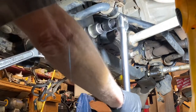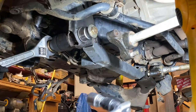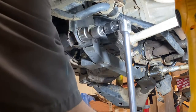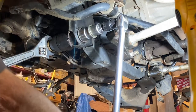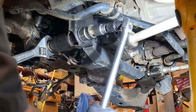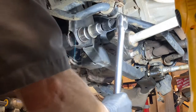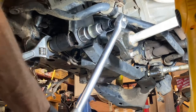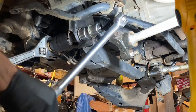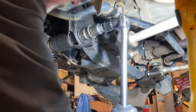Something definitely popped there. Let's keep turning. I think I got it — it's going in. All right, that's what I needed: a good three-quarter bolt. I had that five-eighths threaded rod in there, which is like a number two steel. This is a grade eight — it's got to be rigid, you can't have any flex. Of course this three-quarter breaker bar doesn't flex at all.